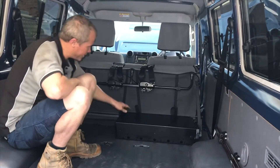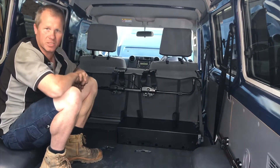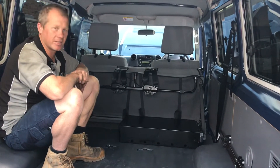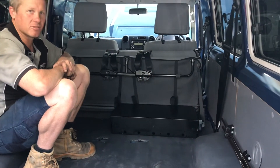And there we have it — fully housed and encased in an aluminium box. So he can still load gear up in here, doesn't have to worry about shorting anything out or the battery damaging anything. Everything's housed inside that box. We also have the Redarc DC-DC converter mounted up to the side there, where we can still see its operation.